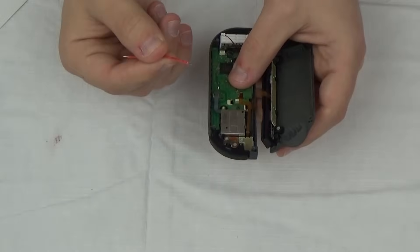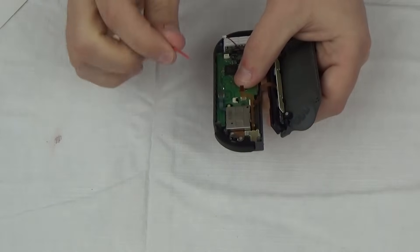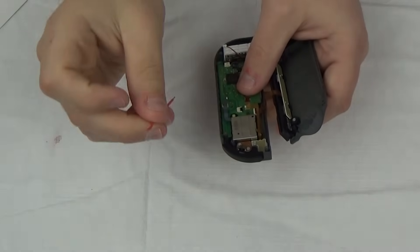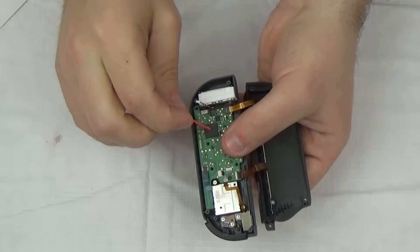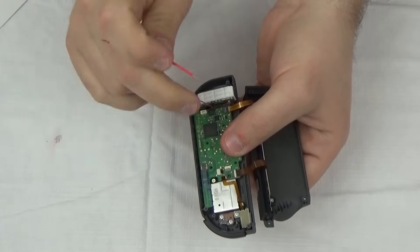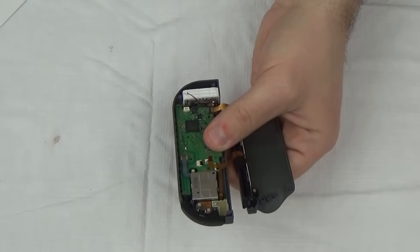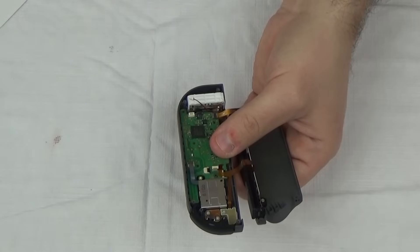You could probably either take this metal box off, but that would take away the structural strength of this Joy-Con. Or we can run the antenna the opposite way — we may be able to solder and just move this antenna down using a standard cable. You can use cables to extend antennas; that's perfectly fine. Looking at the board, here's the Broadcom chip. It runs a trace all the way down, hits a blob of solder, which may be where an antenna would normally attach, then runs up into the carved-out antenna in the PCB at the top. I'm not sure why they went with that design — possibly to save space or money, since you can just etch it into the board.